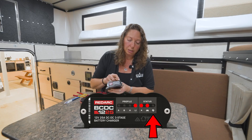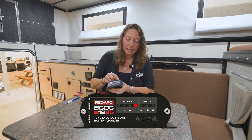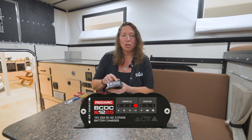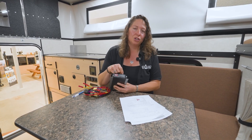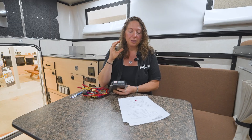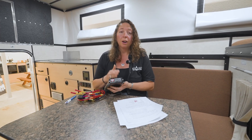The third light is going to be the stage of charging that it's at. If you're not seeing any light for either solar or truck charging, it means the system is not seeing a charge coming in through that channel. One thing to know is that even if the system is working properly, you might not see a charge coming in through the lights, because when the battery is over 90% it wants to protect the batteries from unnecessary wear and tear. Using the light indicators there are other codes the system can tell you — please refer to the owner's manual for more information on those codes.